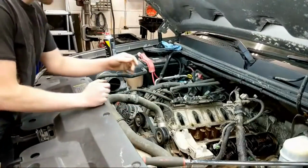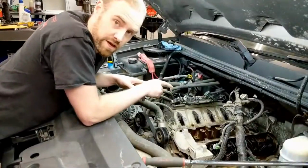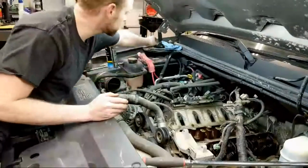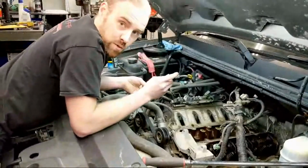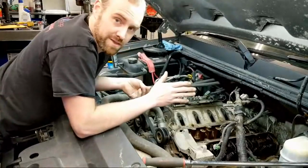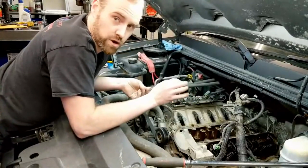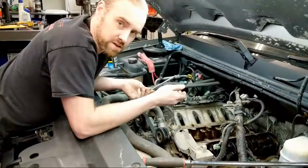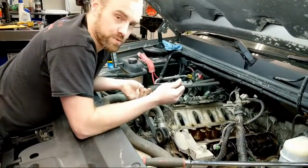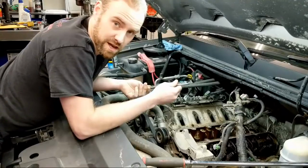Okay, what I'm going to do is look down that hole, and then use this to turn the... just set it down. There it is. This is to make sure that where this tool lands on the lifter is not going to land in a spot that's just offset of the little oil hole in there, because if I land on that little oil hole offset, I may damage the lifter. That was brought to my attention on the last one that I did, that I damaged it.